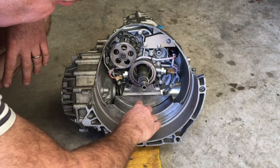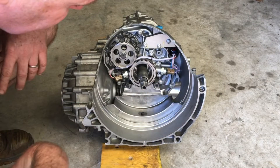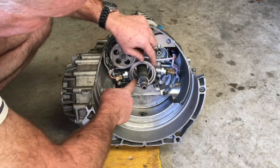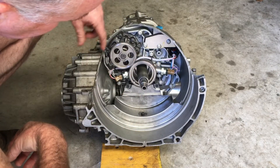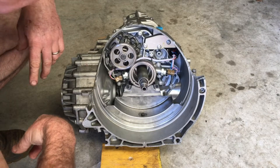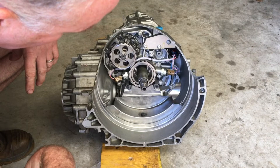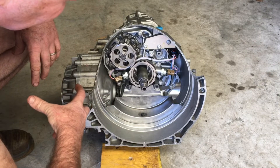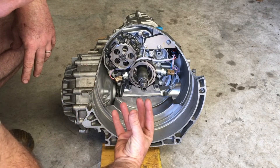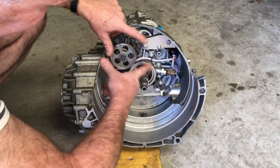The way this is set up, we've got a baffle at the front, the electrical harness, the plug goes down there and the rest goes down to the valve body underneath. We've got the oil pump here, driven by the clutch pack — it slots into these slots and moves around. We've got our two clutch pressure sensors, then behind that the pump, and behind that what I'd call the intermediate plate, which does a lot of the distribution of oil. From the underside of the valve body it can distribute oil directly underneath, but anything on this side has to go via the intermediate plate.